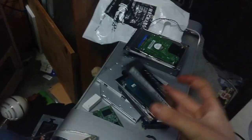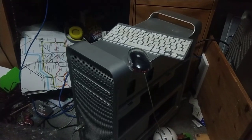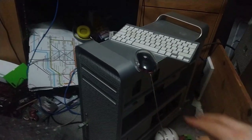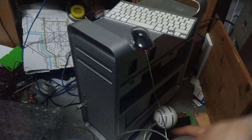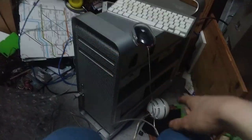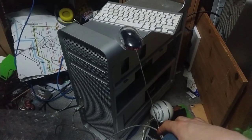This, you know, isn't mono partition, so I'm fine with that, and I'll probably give myself a bigger home directory. I won't do half and half. I'll probably do more or less, like, I don't know, 100 gigs root, and then all the rest, the 360 home. That's the idea, because Steam games go into the home directory, and you know, Steam games are quite big, so yeah, that's the plan.